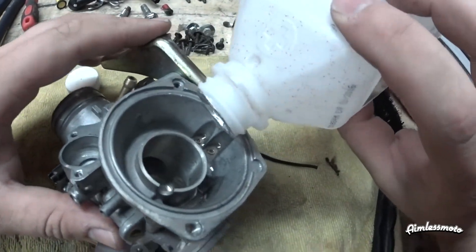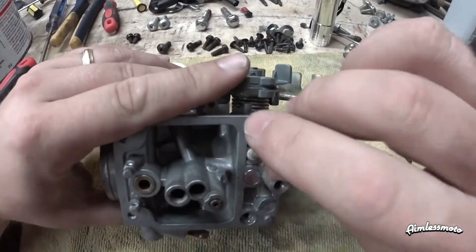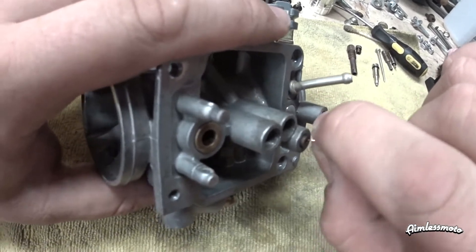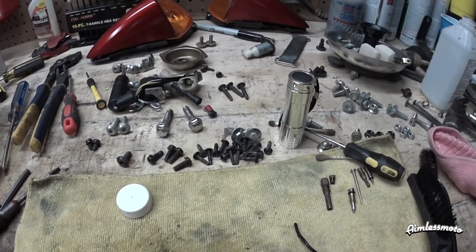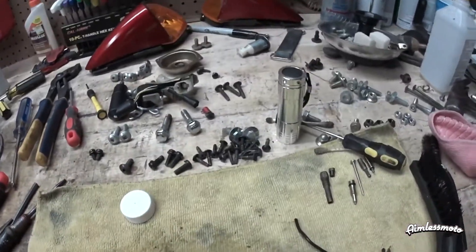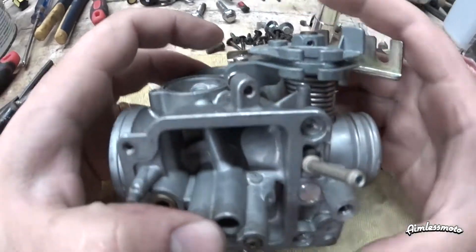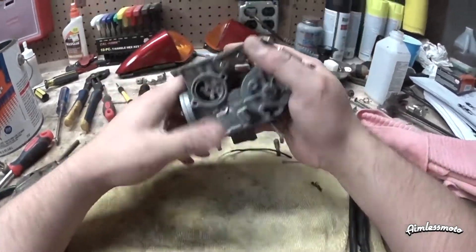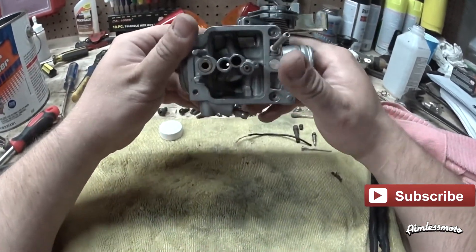Put a little alcohol down those just to see where they go. There's this one port — that's not a good sign. Blowing through that one — comes right through there, nice and clean. I think we're in good shape here. Every port is now clean, every hole is clean. Every inlet and outlet you can tell where it goes, there's no crud anywhere, and it's completely dry. We have a 100% clean carburetor.